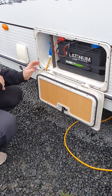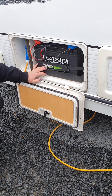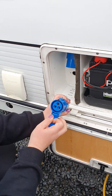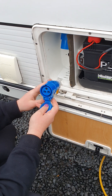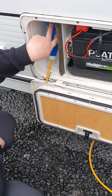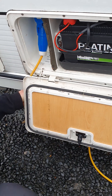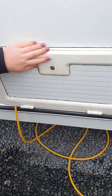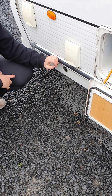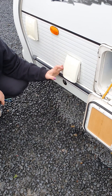In this locker here is your 12-volt battery — you don't really have to worry about that, it does its own thing, but this is where it is if you ever need to change it. Just in the compartment next to it is your main power connection. There is a groove on your cord which matches the one on the van so it can only go on one way — hold that cap back, push that on, release the cap and there's a little catch that hooks on to keep the cord in place. There is also a groove in the locker and the lid so you can pop the cord there and lock the locker to stop the weather getting in and to secure your battery and main connection.